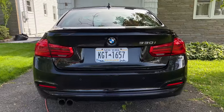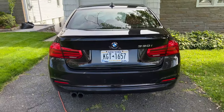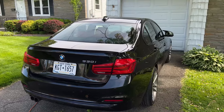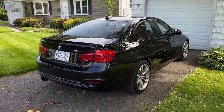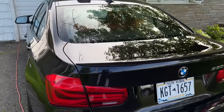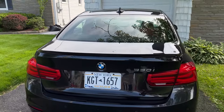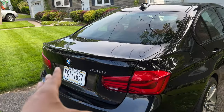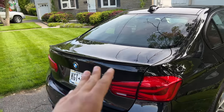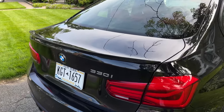The spoiler is installed and right off the bat it looks so much more aggressive. It's funny what a difference a subtle small spoiler can make on a car. Something to mention — I did go back off camera and hit the spoiler and specifically the adhesive with a heat gun, just so the adhesive loosens up a little and gets softer for better adhesion onto the trunk. That's probably not necessary if it's a hot day, but if it's cooler out — like today in the 60s — definitely do that so it sticks better.